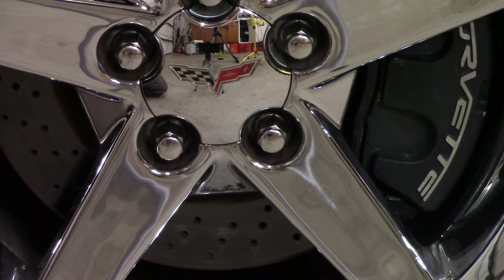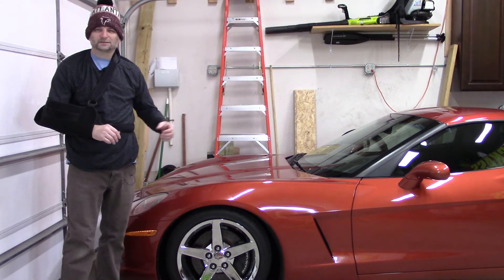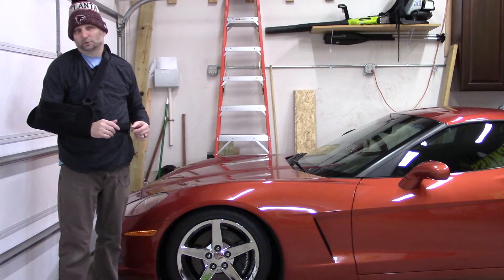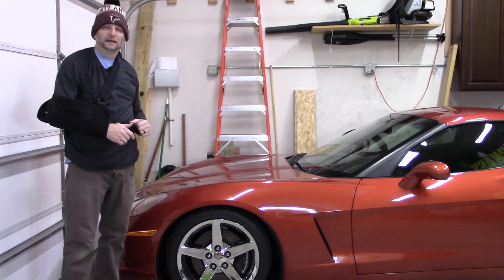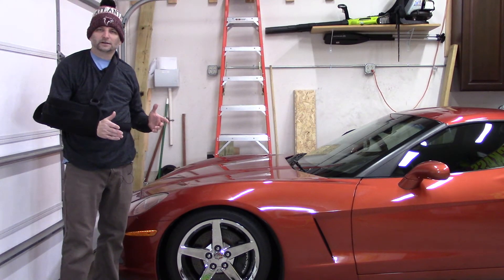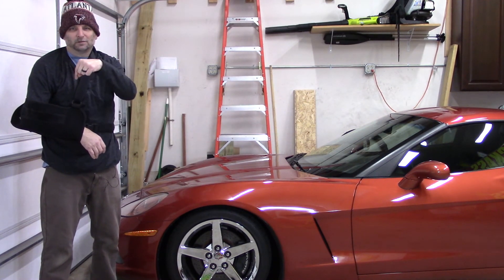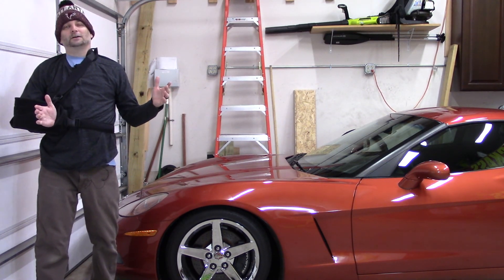This applies to your rear rotors as well. The front rotors take more of a beating, so it happens more up front. Typically you change your front rotors twice, then your rear rotors once, but not every vehicle is the same. Hopefully that helps with some visual representation. I like to follow the Porsche seven millimeter crack theory, but both Porsche and GM have the same rule: if one hole is connected to another hole, or if it hits the outside edge of the rotor, it's too much and needs to be discarded and changed. Hopefully that helped out. Thanks for watching Maintainer's Garage — hopefully this won't be much longer and I can go back to making videos at some regular interval. I appreciate you all. Have a great day.